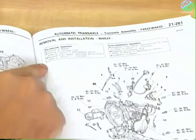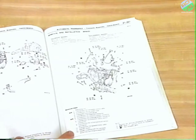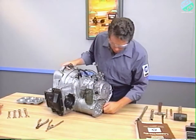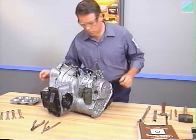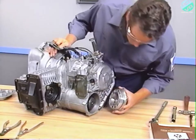When removing the transaxle from the vehicle, use the procedure in the Laser Talon or Vista Summit Wagon service manual. And be sure to follow the steps for removing the drive shafts from the transaxle. Improper removal of the drive shafts could result in damage and unnecessary replacement. With the transaxle on the bench, remove the bolts from the output bearing retainer, and remove the retainer and race.